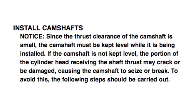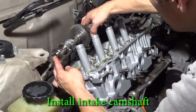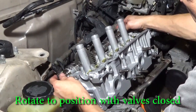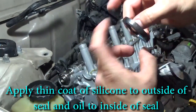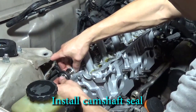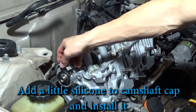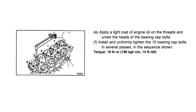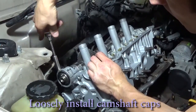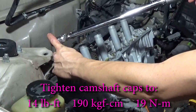The camshafts also require a special installation procedure. We want to turn the camshaft so they're not opening the valves during installation. We're going to rotate the intake camshaft until it sits at its lowest point — that means there will be the least amount of pressure when we install the caps. Put a little bit of silicone on that camshaft seal and put it in place. Next goes the camshaft cap — I also like to put a little bit of silicone on the sealing surfaces. Sequentially tighten all the camshaft caps, first a little bit at a time, and then torque them down. The torque specification is 14 foot-pounds.